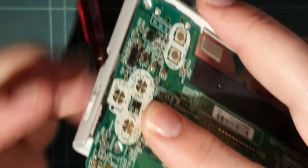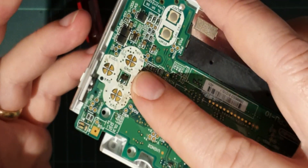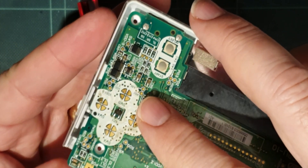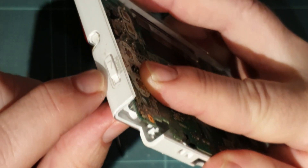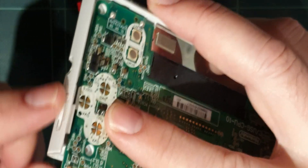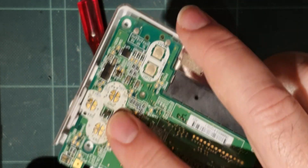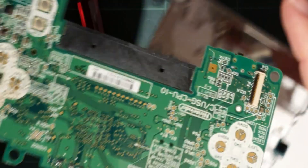So if it's just that — if you put it back together and you try to move the switch and it's stiff — take it apart again. Of course, you shouldn't ever take your DS apart because this is how you break it. So you've got two things: if the switch doesn't move when you've reassembled, don't force it — it just means the switch is the wrong side. If it moves freely and doesn't spring back, you've probably broken your switch. I've got other videos showing you how you can have a go at fixing your switch, but to be honest the best thing to do is just buy a spare board off eBay that works.